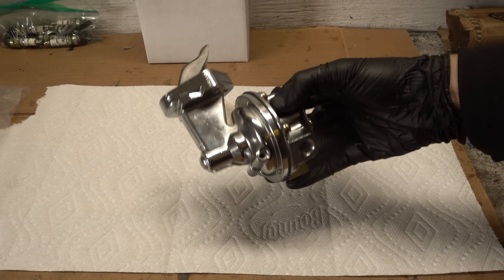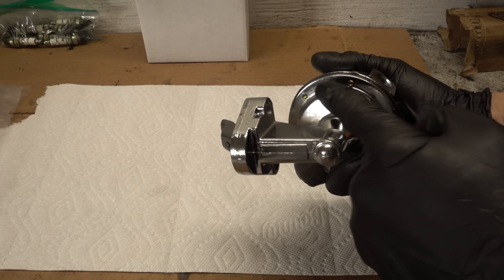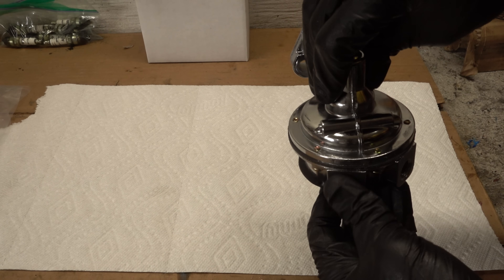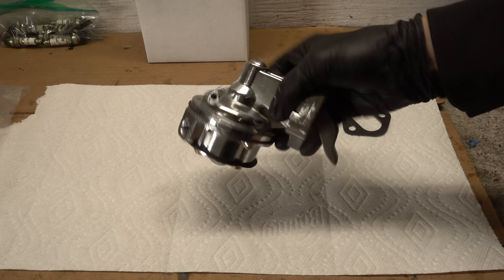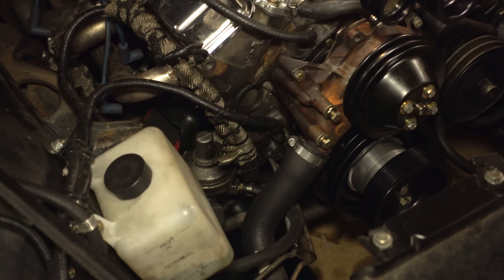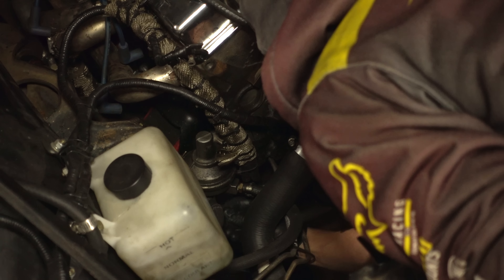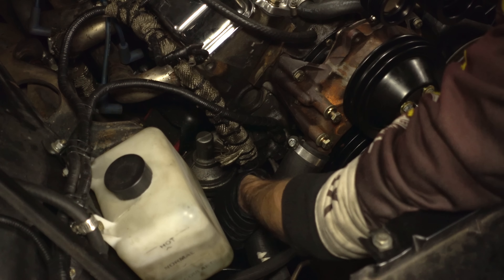Here's the new fuel pump — it's from Summit and it's 80 gallons per hour. This is a clockable base, so you can take out these screws and reinstall them one step over if you need to rotate the outlets. I might need to turn it just a little bit because it gets close to the frame. Near as I can tell, these are the same as the Holley ones — they just cost half as much because they don't have that brand name on them. I've actually replaced this pump before because the one it came with cracked — one of the fittings cracked off and it was leaking gas.